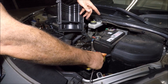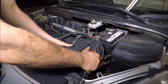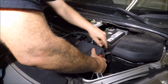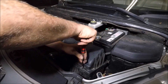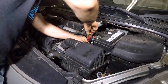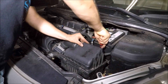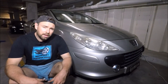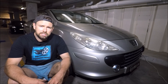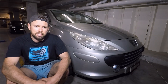To replace, just drop it straight back in, rotate the air box lid back down, and screw the screws back up. And there you go — that's how to remove and replace an air filter on a 2008 Peugeot 307 CC. If you found this video helpful, please give it a thumbs up and subscribe to my channel.